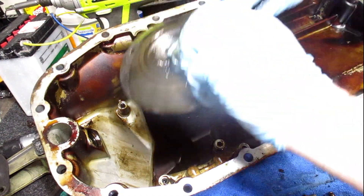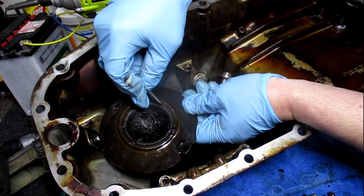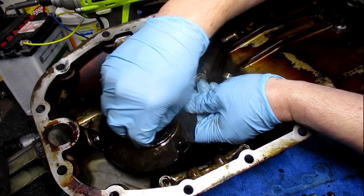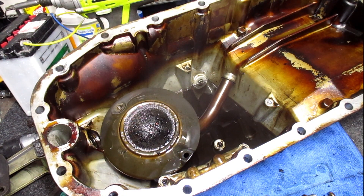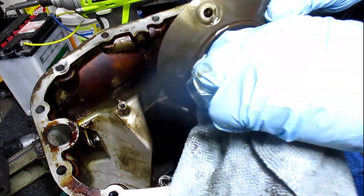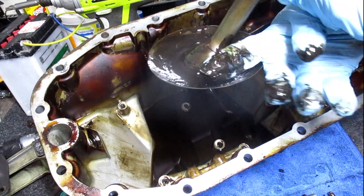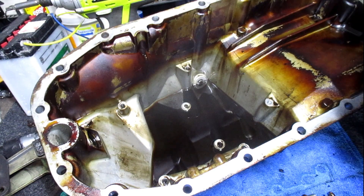Let's see how much of that is metal. None of it — no sludge on the end of the magnet. That's gasket material, carbon, and RTV. A little bit of sludge there on top of the pickup, but not much though. Let me dump this oil out and we'll see what's in the very bottom.